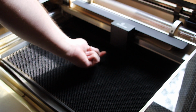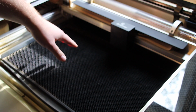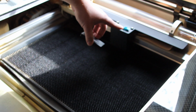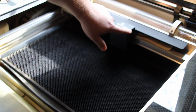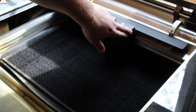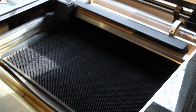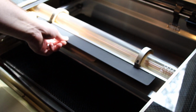And there's a lens right underneath the Glowforge head, the main lens under there. You will need that blue lens tool. You can check out that video that I'll link below as well. And then there's a mirror that you pull out right here as well. All of that is in detail in that other video, so you can get a closer, better look and a better camera angle. You'll want to make sure all of your lenses are clean, because if your lenses are dirty, the laser isn't going to get through at full power, and that's going to cause all sorts of issues. So next up, what you want to do is clean your fans.